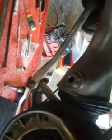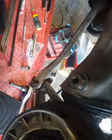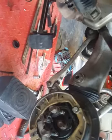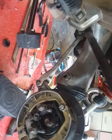there is the big pivot pin, which, as you can see, is still just sitting proud at the moment. Now that, according to the manual, gets torqued up to about 110 foot-pound, and that'll tell you how much stress and strain that takes and how little you can afford to have that pin work in the alloy housing.